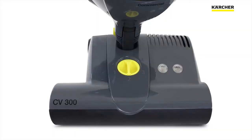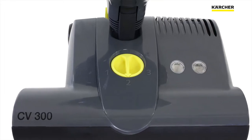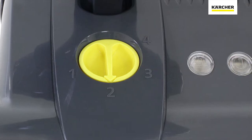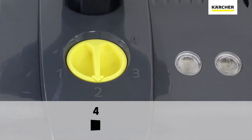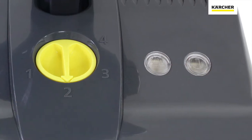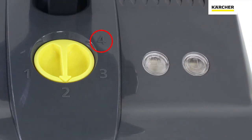Let's take a closer look at the base of the unit. We have a large dial that adjusts the brush up and down — that's our brush height adjustment, with four being the highest and one being the lowest. Whenever adjusting the brush, always start at four and watch the brush indicator lights. If both the green and amber lights are illuminated, we're not adjusted correctly. Lower from four to three to two to one until the amber light goes off and only the green light is illuminated — that tells you it's adjusted perfectly every time.